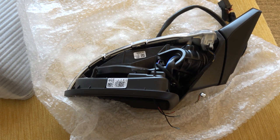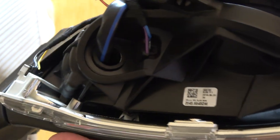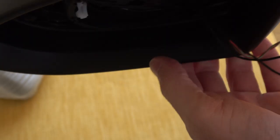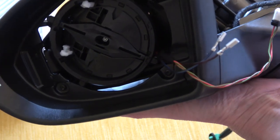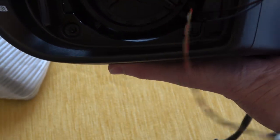The first piece you're going to need is the mirrors - the power folding mirrors, left and right. The only difference between this mirror and the one on the car is there's a motor to twist the mirror back and forth. Everything else is the same. It actually comes with another turn signal light bar already installed. This is a factory Volkswagen mirror. I got this from EACCA.com, a company in Latvia that is well known in VW circles for factory parts - they get all their parts from VW directly and ship them to the US. Make sure you get the right one with or without driver assistance, as the driver assistance version has an extra wire for the blind spot monitoring.